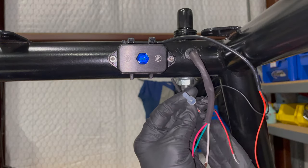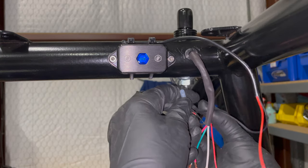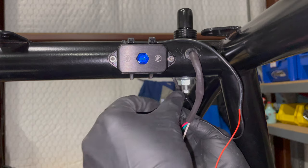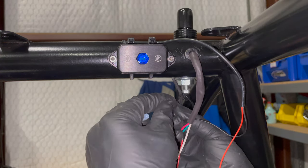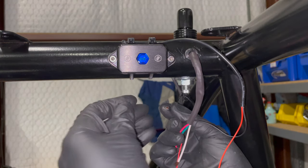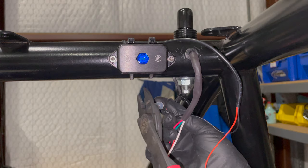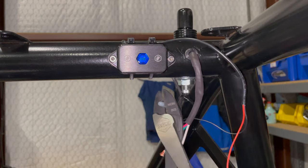So these ice cream cones are made for certain gauges. This is a medium size one. They make them bigger and smaller. You could use a wire nut in the same fashion as an ice cream cone. I don't like using wire nuts on things that move. Wire nuts are fine in houses, but in cars, they get wiggled around and it's just not ideal.